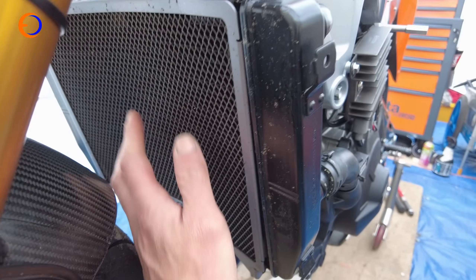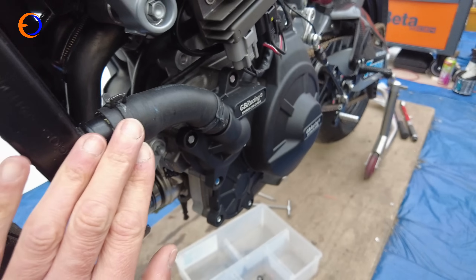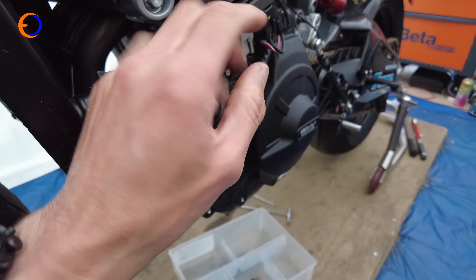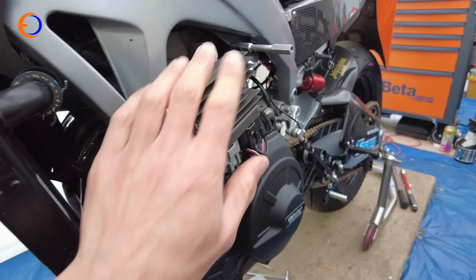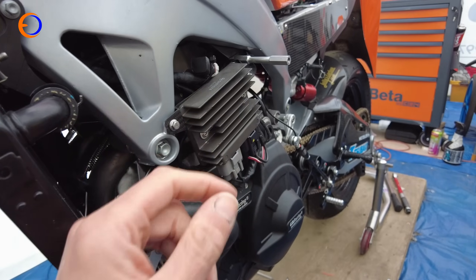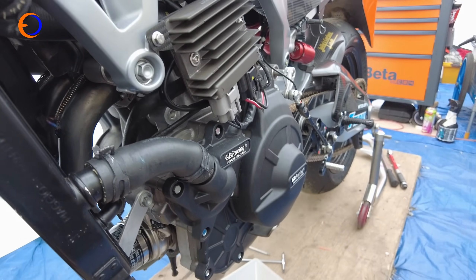We'll come down and check the radiator — make sure there are no impact marks, damage, or debris, and I'll wipe the flies off it in a minute. If the fairing sits a little bit tight it's really easy to rub a water pipe, so always check there's no damage on the water pipes, check brackets are tight, and make sure the wiring isn't wobbling and scuffing or fretting. You get more things wearing and coming loose at TT because you spend more time flat out, there's more vibration, and you're doing more mileage than on a short circuit — so it's a good chance to touch everything and do a really thorough inspection.